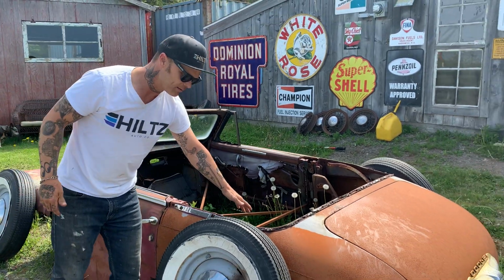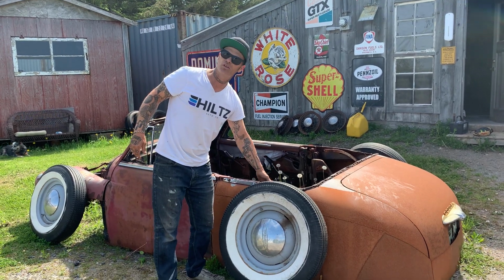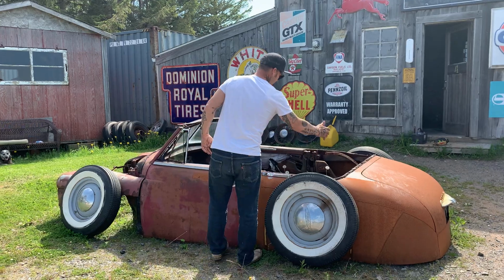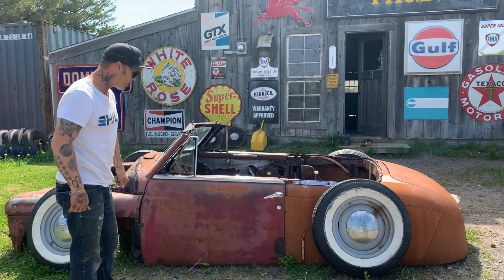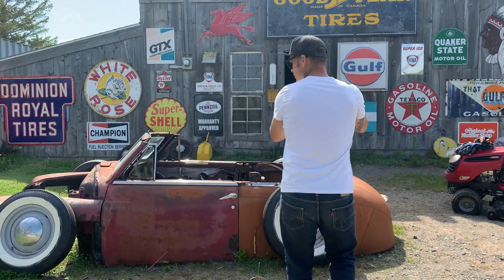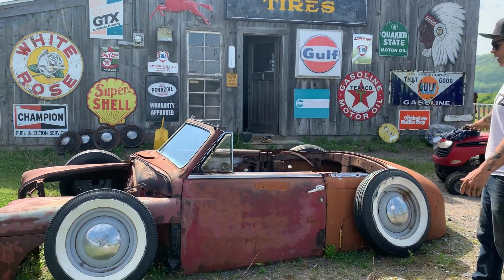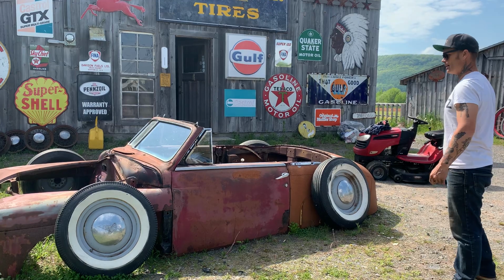As you do that, and you put your suspension or your frame in it, if you air ride at the back, well, then you would know exactly, because you would have it decompressed. That's where it is on the ground. So when you build the chassis and the air ride, you would build it decompressed. And same with the front. So when you're all done building your chassis and you put your car there, when you pump it up, you've got your 6 inches of bag, you've got your ride height. And that's how I do that. Rear end, put a front end, and then connect it together. Build the chassis. It's pretty basic. That car will tell you exactly, if you put the car where it's at, what you have to do to make the car sit like that.